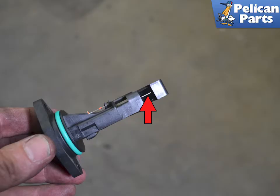The small wire in the opening of the MAF can become amber in color over time and get what looks like a coating on it. You can try spraying this part of the sensor with MAF cleaner and letting it dry, then reinstalling.